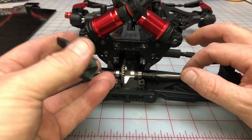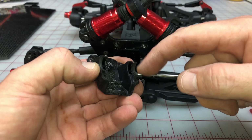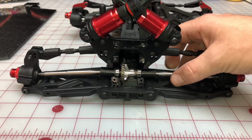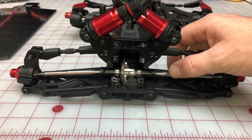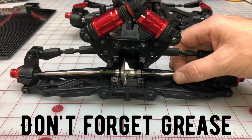If you're putting your cover and it adds a lot of resistance, take the cover back off and Dremel here a little bit, just so it's not pressing as hard. What you're trying to do is to have 0 resistance, well, not 0 but close to it, for your car to actually propel those axles.